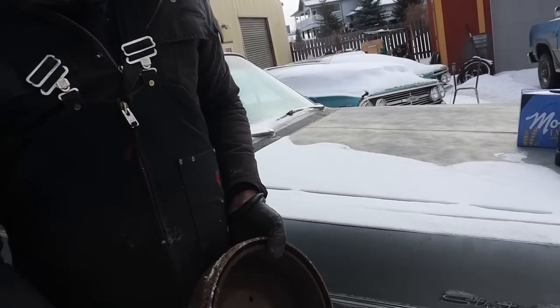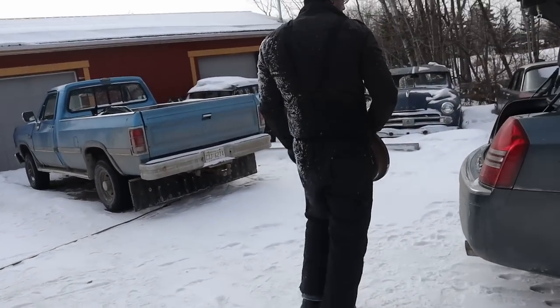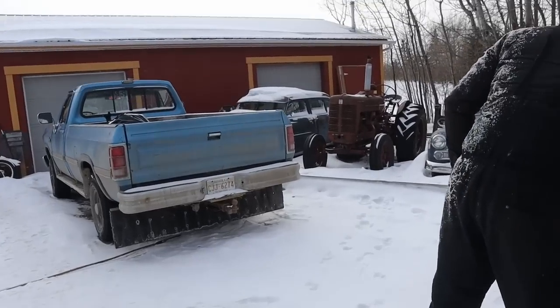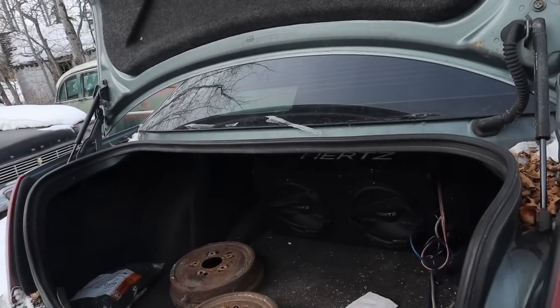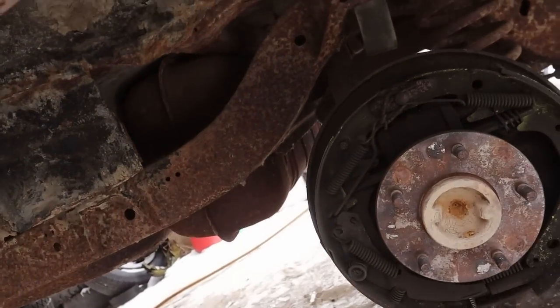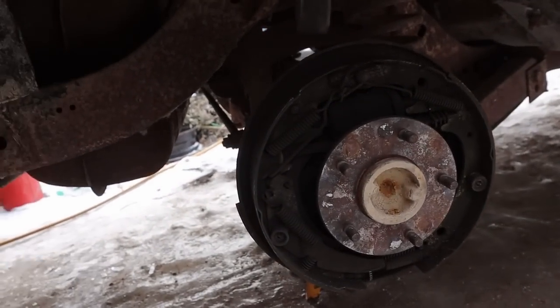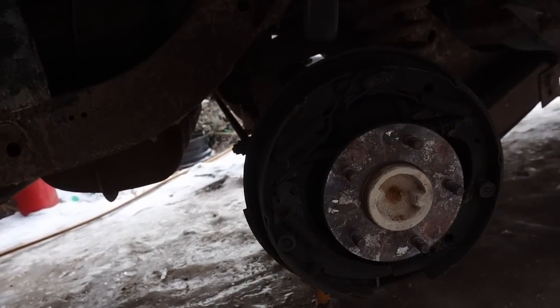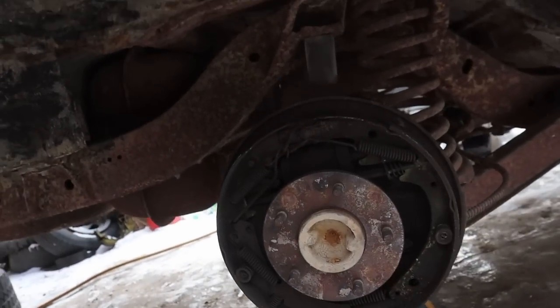Again, pretty heavy-duty brakes for such a light car. Right? 11 by 2s on the back. With only a six in there, how fast did they really get going? Not going to give any trouble. Yeah, they're down to 1%, but that's okay. Is that next to metal? No, there's just like a paper thickness of lining. Well, that's good. Somebody got their use out of those.